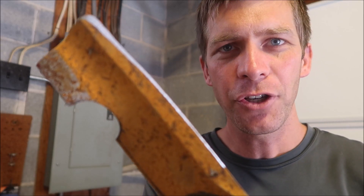Now I've actually got a nice edge on this blade. It's hard to see from the video but I can feel it, and that's about what I was going for — taking a little metal off. When I was mowing full time, I tried to sharpen my blade once a week. I've heard of people who even carry a battery-operated impact wrench out in the field and change blades in the middle of the day — twice a day — but that's extreme. Once a week if you're cutting full time is reasonable, but it's about trying to make money and not always working on equipment. I found that doing it once a week along with blowing out the air filter and greasing the mower kept me going.